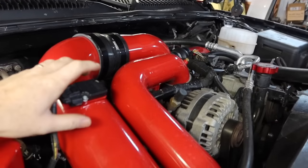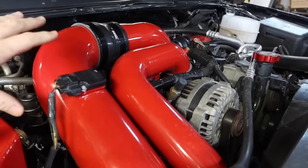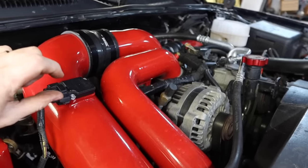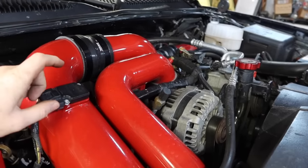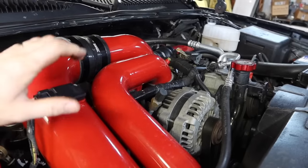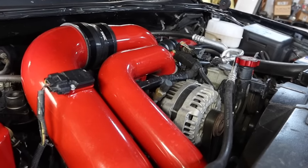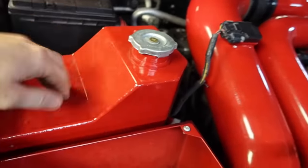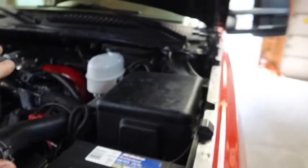This is called the mass airflow sensor — it's in the ductwork of your actual air intake system. When you remove it, you're going to see a little sensor right inside there. Go to your auto parts store and pick up some mass airflow sensor cleaner — just a little spray. Go ahead and clean that out, let it dry, and put it back in. I've actually seen the truck run better — more responsive with better fuel economy — just by cleaning that little sensor. Also make sure your coolant is topped off, as well as your brake fluid. Inspect the brake fluid to make sure it's not all nasty and dirty.